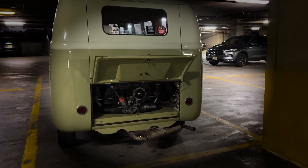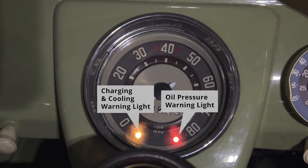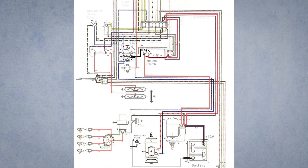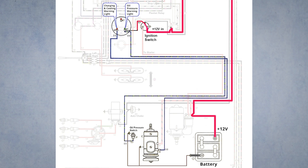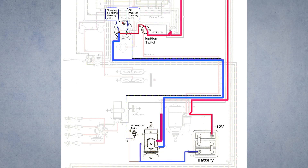Next day I started troubleshooting. Usually when we turn on the ignition key, both the oil warning light and charge light turn on, but the charge light didn't turn on this time. The warning light is an important part of the charging system. 12 volts from the battery is turned on by the ignition switch, goes through the light bulb, and flows to the terminal on the alternator, signaling the alternator to start generating power. If the light bulb is out, the alternator will not start generating power.